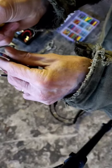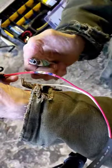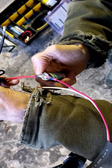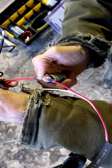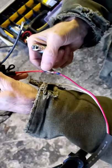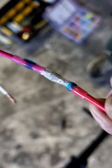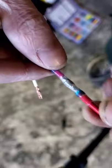Once it's cooled enough, I'm going to flip it over and heat it from the other side — it's so cold out. If you're in a warmer area, you won't have to do this step. I'm just watching that blue adhesive — when I see it squish out like it has on these ends, I know I've got it. That one's good. Let that all cool and you've got a good soldered connection — you can see the solder went right down into those wires, the adhesive has adhered, and you can tug on it and know it's safe.